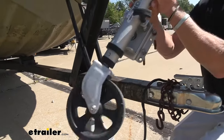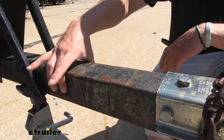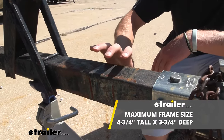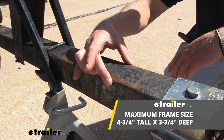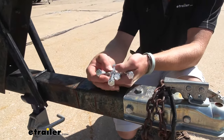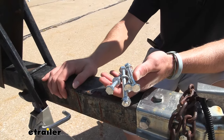Now with that done, you can go ahead and do whatever you want with this thing — toss it to the side, throw it away, we're not going to need it. You want to make sure it's going to fit your trailer tongue. The maximum height is going to be about four and three quarters inches, and the width needs to be no greater than three and three quarters of an inch. We already did our measurements and it's going to fit. One thing nice about this is you don't have to save the hardware from the old jack. We do get brand new hardware and that is awesome. So we can upgrade the hardware and the jack all at once.